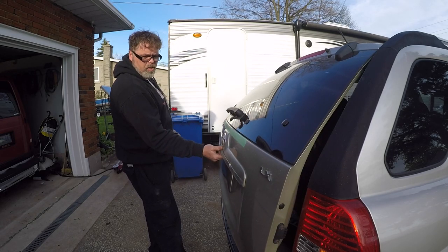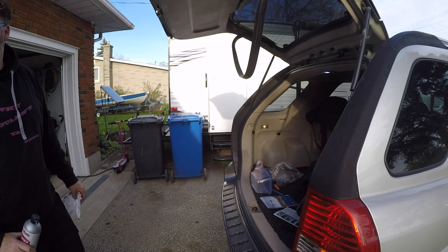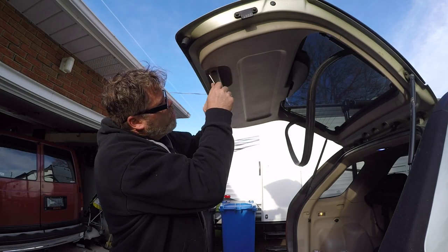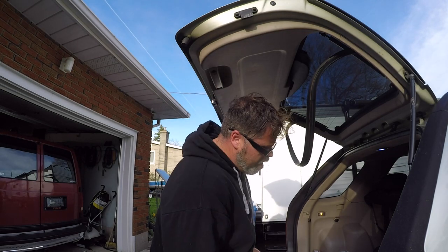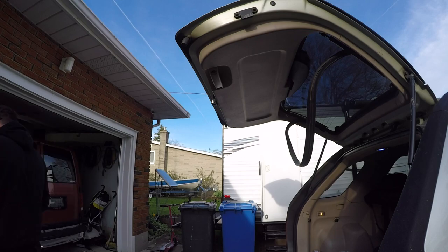Now we're gonna open the gate and pull this thing off. We're gonna have to remove this air panel, which is pretty straightforward. First thing you want to do is remove the clips. They show a screwdriver but they're stripped, so all you gotta do is pull the clips out like this and they come right out. Take off the covers that cover the screws for the hatch cover and remove the one on the corner. You're gonna need a star-head screwdriver and a seven or eight mil socket.